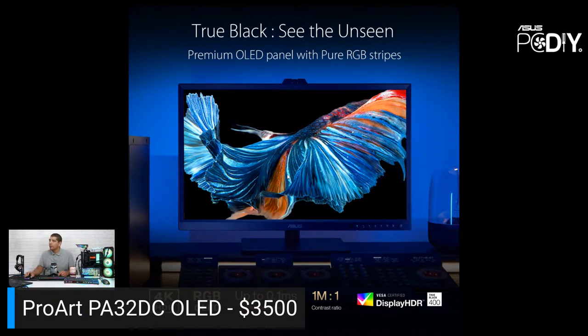Okay. And of course, a big thing right here is that 1,000,000 to 1 contrast ratio. That's really the big benefit of OLED, compared to even the best IPS based displays, VA based displays, other panel technology. The only thing that can really rival this is something that hasn't been introduced yet, which would be micro LED technology. This essentially means that these pixels can individually turn off and on, and this allows you to have true black performance and really impressive color gradation, as well as uniformity across the panel. Uniformity means the consistency of the light output across the entirety of the display.